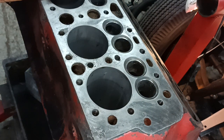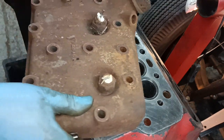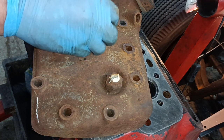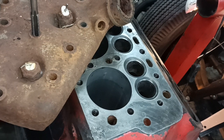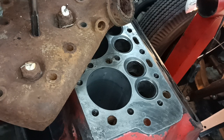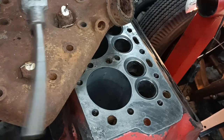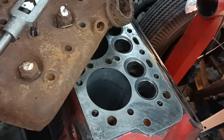Right, now this here is a 21 stud pilot cylinder head, and I used this when I was doing a heli coil repair before, and this hole here has this thread down it. So what I'll do, I'll wind that thread down there, well, I'll try to, just to clean the thread, because it's a bit rusty. That's got that thread, you see, but what I did, I put it on the milling machine and tapped that. So this thread is square to the cylinder head.